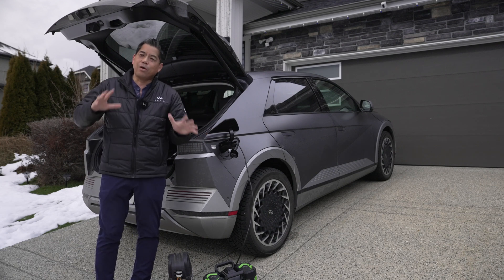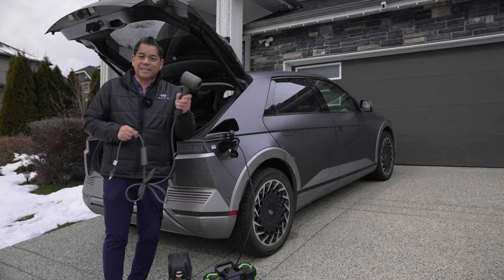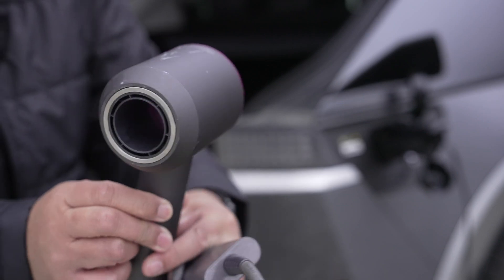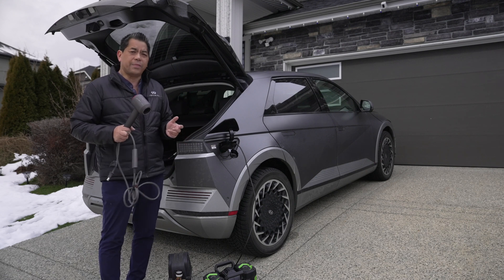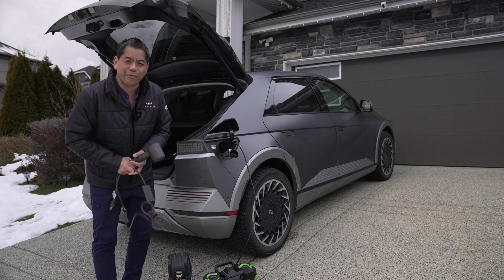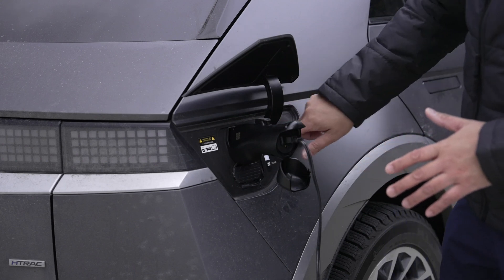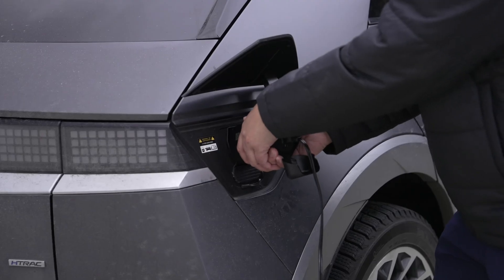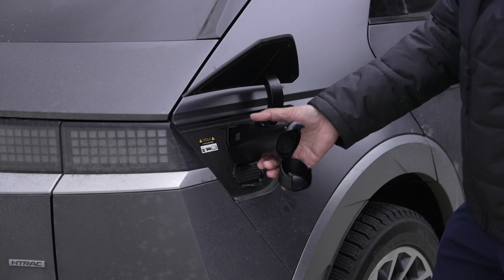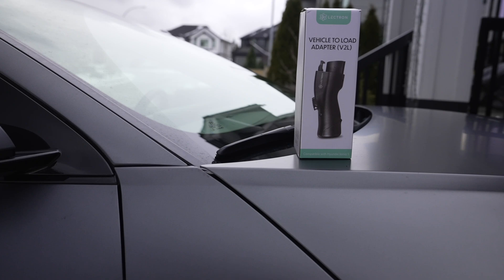One thing I thought would work — and it could be very handy for campers using blow dryers — the Dyson blow dryer, the fancy one, even though it's 1600 watts, which is 300 watts below the 1900-watt limit, it powers on but will not blow. That's with both the internal and external adapter. The Dyson has some sort of different protocol that doesn't work with V2L. So if you want to power your Dyson with this or the internal one, it's not going to work. Also note that when the adapter is activated — as it's flashing — it actually locks on just like a regular charger does. Once you unplug the device, it becomes solid, and then you can simply pull it off.